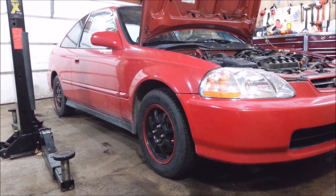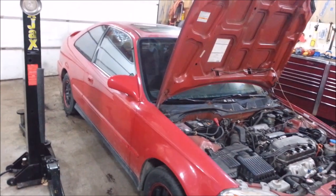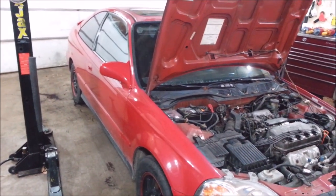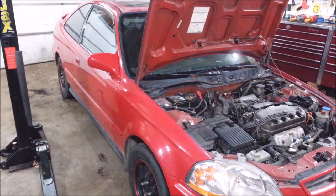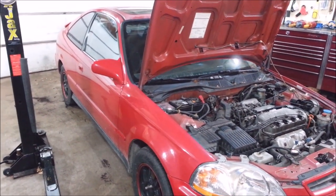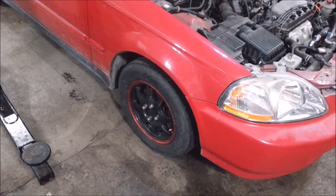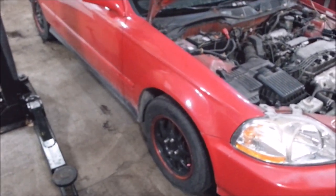Today I've got my little hoopty in here — my low-buck build, a 96 Civic EX. I'm going to do some suspension work on it. I did a video on a sway bar — I put a 15mm twin-cam Del Sol rear sway bar in it and it really helped with body roll, made a very noticeable difference. I still got a little body roll, I don't like the rebound on the shocks. I want a nice firm, comfortable, responsive performance ride — not too stiff. I've got 14-inch HX rims on it; I like those. I've got some 15s but I'm not putting them on yet — I don't want to go higher than 15s because it makes the ride real stiff.